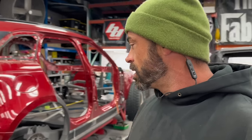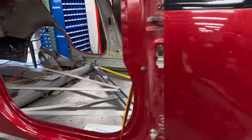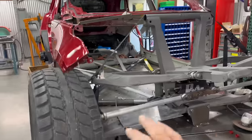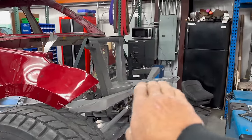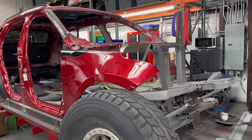We are in phase two of the Dakar prototype. We've got all of our cutting done — all of the shell, all the junk, the fat trimmed out if you will. Everything is prepped, everything is put away, all the scrap is where it needs to go. Colin attacked the shit out of this thing — carefully deconstructed and removed all the wiring with no cutting of wires, not doing anything that's going to compromise the electronics in the future. We got everything to a point where we could get this thing on the fixture table, and that's where we have it now. We've already spent some time getting the wheelbase set up and the suspension where it needs to be. The bulkhead is set, and all of our caster is built into the bulkhead — the actual anti-dive angle of the bulkhead is what sets the caster. That thing is completely square.